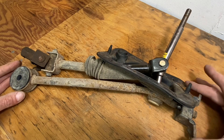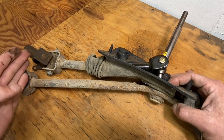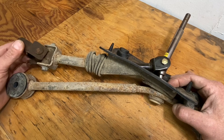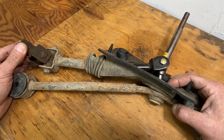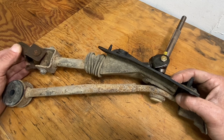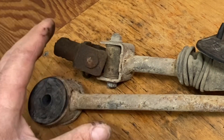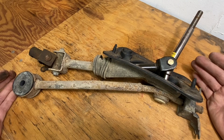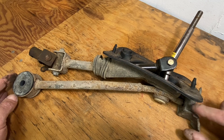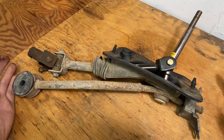Taking a closer look and orienting ourselves - this is basically the rear of that shifter assembly, where we had those two bolts that bolted in underneath the vehicle with the 12 millimeter bolts. And then this half on the left is the front of the vehicle side - this is that lower one that actually goes over that stud with the 12 millimeter bolt. And this is that U-joint that had the little roll pin - I used the little vibrating hammer tool to pop that roll pin out, and once you pop it out you can see the hole for the roll pin right there, and this little U-joint apparatus actually slides right out. Incidentally, this little U-joint actually has a bushing in here that wears over time, so it's definitely a good idea to replace this little U-joint when you replace or upgrade your shifter assembly. There are actually companies that sell polygraphite bushings for your stock shifter assembly - when you buy those, you're typically buying a bushing for the back and a bushing for the front. And I definitely recommend you replace this little U-joint up here as well. That is a stock OEM shifter assembly.